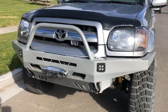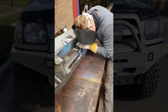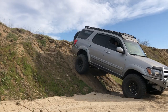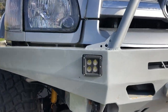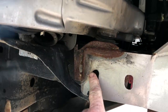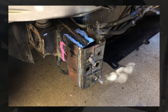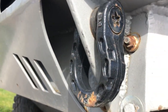The front bumper is a weld-it-yourself kit by Coastal Off-Road — basically an adult jigsaw puzzle that can hurt you. This was my first welding project and I learned a lot. These are high-clearance front and rear bumpers — going down a fairly steep incline, neither bumper touches the ground. They really help with approach and departure angles. I got it powder coated to match Toyota silver. The lights are from Harbor Freight and the winch is a Badlands Apex 12K. We had to extend the frame rails about an inch and a half to fit the winch, so I just welded the bolt holes.